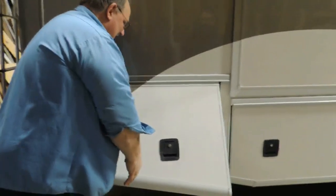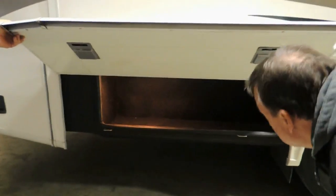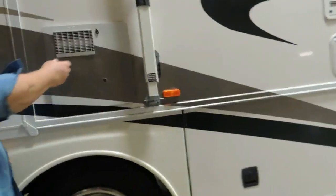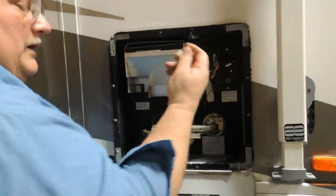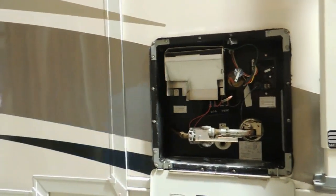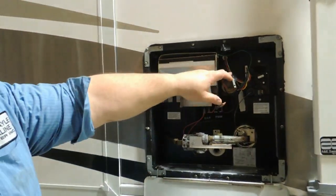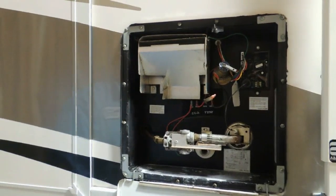More storage — you're going to find that a lot. It's got a full basement. There's a light and everything. Water heater is in here. The drain plug needs to be installed in the spring — it'll just screw right in. Your pressure relief valve is located right in here. Keep in mind it may drip water when the heater is in operation, so don't be alarmed. It's both gas and electric.